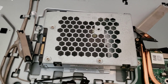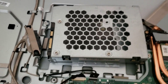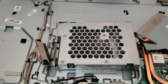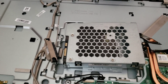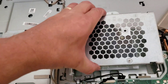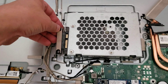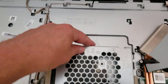I've screwed the SSD in with three screws. Note that the screws it shipped with are heavy-thread and you need fine-thread for the SSD, so I had to swap them. Practically speaking, an SSD doesn't even need to be screwed down — no moving parts — but it's bad form to leave it loose. Now let's slide this back in, put the SATA connector on, and put the screw back in.